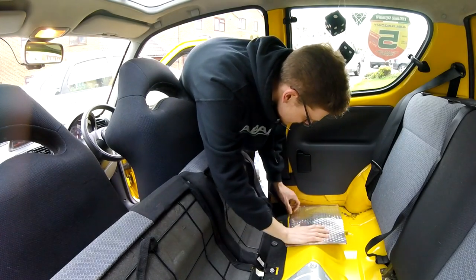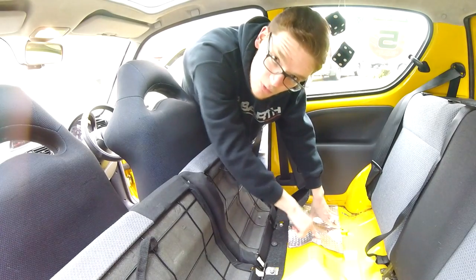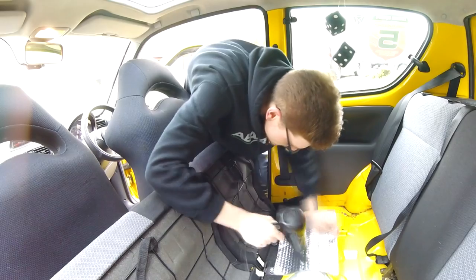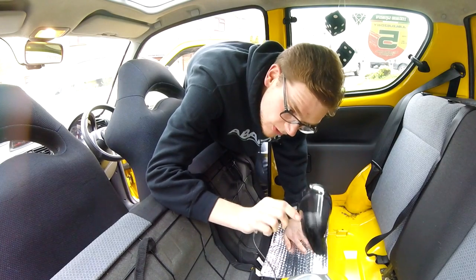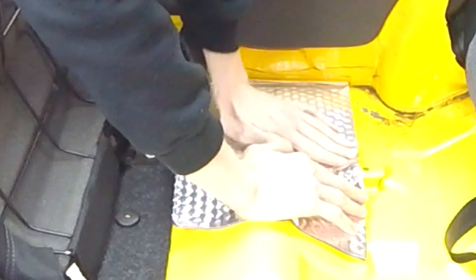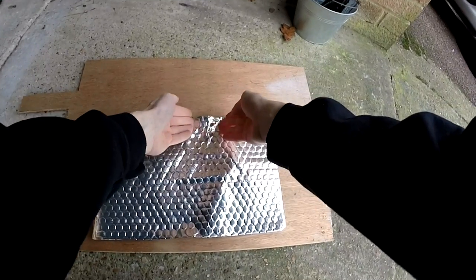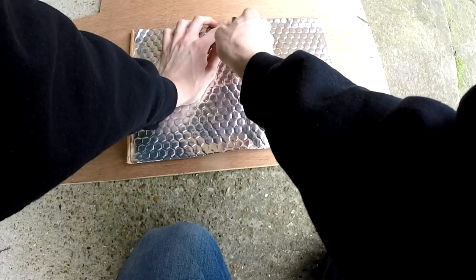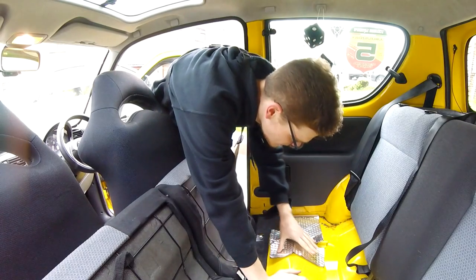Next up we need to see how well our lovely sound deadening mat conforms. I can kind of fold that curve, but this little notch in the floor pan — I'm not going to be quite so happy about that. So we're going to warm up the sound deadening pad, see how well we can make it conform, and go from there. You could use a heat gun for this, but if you haven't got one, a hairdryer that actually gets hot will work just as well. With a bit of heat in it, this thing conforms really nicely. There is a little bit that's not going to fit over that lump quite so well, so I reckon we get it chopped. We've got the little crease where I've managed to mould into it, where it's going to hit that little indentation in the floor — I'll cut into the pad here so we can shape it a bit easier. And as if by magic, it blooming fits!